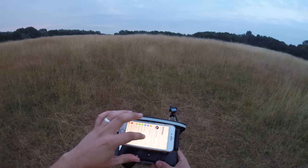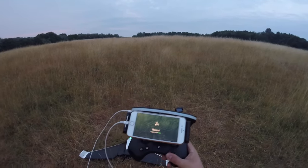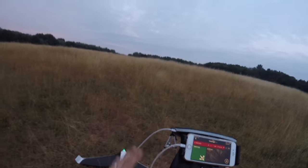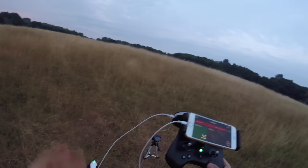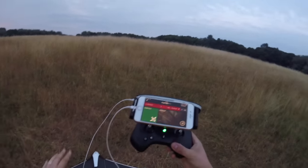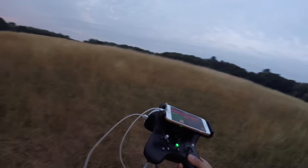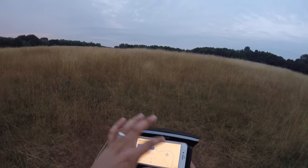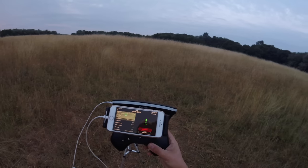While the transmitter is turning on, there we are, we've connected to the Wi-Fi. Parrot FreeFlight Pro was just about to initialize then. Now this cable at the side is very, very important, because if you don't have this cable set up, you're not going to get a proper connection. I did try it and it flickered now and again onto a proper connection, and then it disconnected. So rather than just leave it and hope for the best, we're going to do this properly first time, and that means we need a proper cable. I've tried a couple of compatible iPhone cables, they didn't work, so I've gone for the actual iPhone cable that I had with it, and it worked pretty well, to the point where I think it's far better to use the original one.